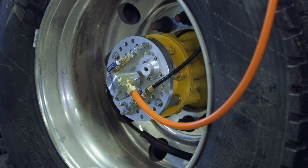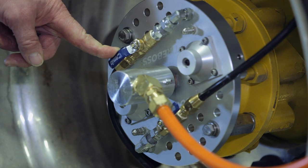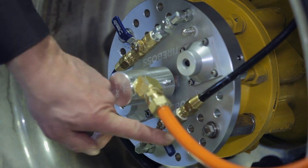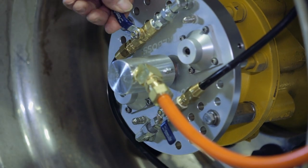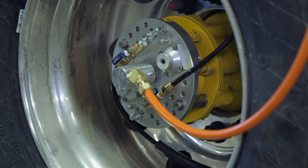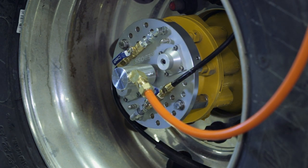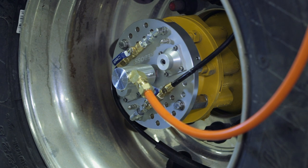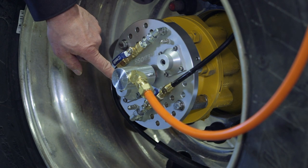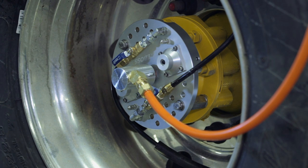There are individual manual ball valves for each tire, which are to be open under normal operation. They are there for servicing of wheels and can be closed in an emergency situation, but must be open when the vehicle is under normal operation. Automatic valves are built in for each tire that close if tire pressure drops below a preset level — for example, 20 psi — as a safeguard to ensure the tires never go completely flat. These automatic valves, built into this assembly, individually close off the supply to each tire at a low set point.